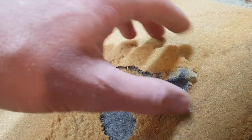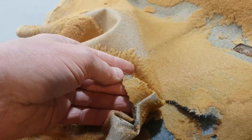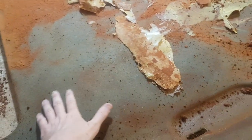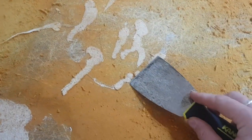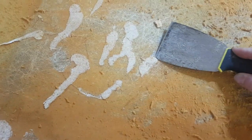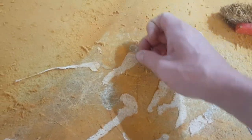Now, let's go into what happens when you do add glue — through an aerosol can or anything adhesive-based, cement glues and those types of things. It can actually bring up the headlining board as you remove the material, because it's not designed for headlinings. When us upholsterers and trimmers go to recover the job and remove the material, it might start to bring up the board with it, leaving a nasty effect. You've got to get in there with a sander and brush it all down, which is a very time-consuming process. It definitely doesn't work and it's just going to create more work and can also damage the board or leave imperfections in the recovery stage.